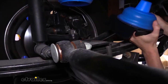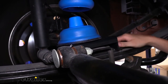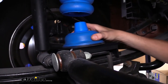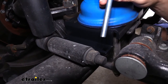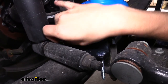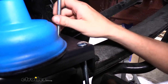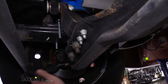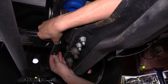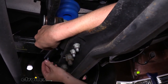Now set the assembly in place. Lift it up above your leaf spring — the ears are going to sit on each side of the leaf spring and butt right up against the little plate at the top. Grab the carriage bolts from the kit: the shorter carriage bolts are your rear two bolts, dropping down through the square openings on each side of the leaf spring; the longer carriage bolts are the front two, dropping through the square holes at the front of the bracket. Underneath each carriage bolt you'll have a strap — slide it over the bolts and give it a little twist to keep the bolts from pushing back up, making it easier to start the locking nuts.